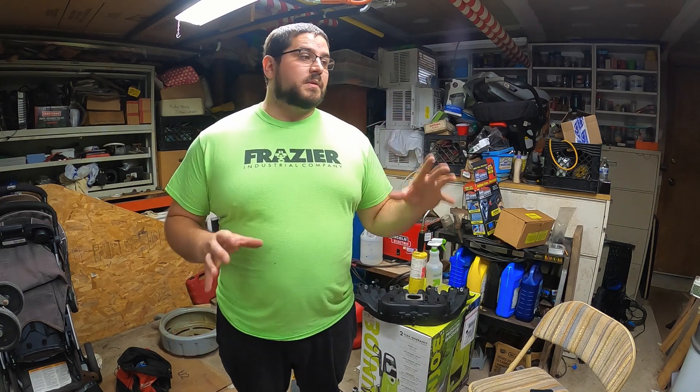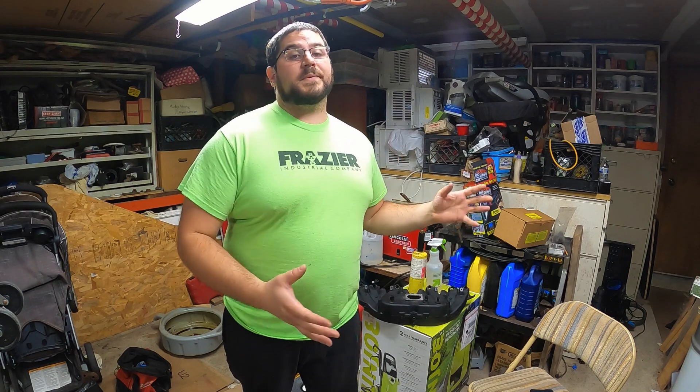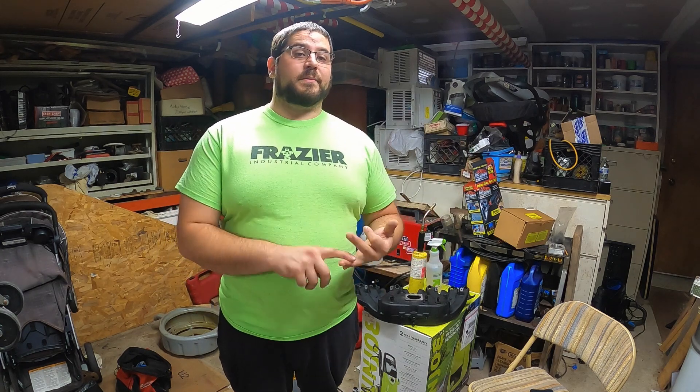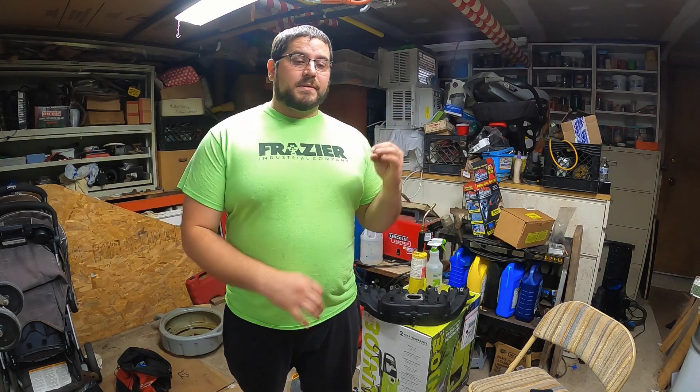I wanted to give you the down and dirty simple answer: is it worth it? 100%. Doug put it in Willy, his 1999 Jeep Grand Cherokee, and I put it in Barney. I put it in Barney about two years ago - I got more power, better fuel economy, better idle. If you've ever listened to a 4-liter where it kind of has a slight miss at idle, it almost goes away when you put the injector in. I don't know what Chrysler was thinking throwing these little stream injectors in. At the time with the technology they had, it worked, and they didn't change it for 20 years because the 4-liter just worked. We all loved it the way it was - that's when we modify things and make them better.